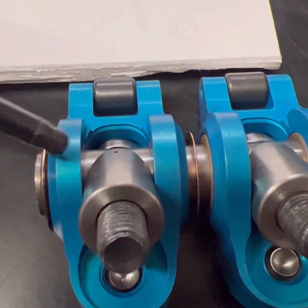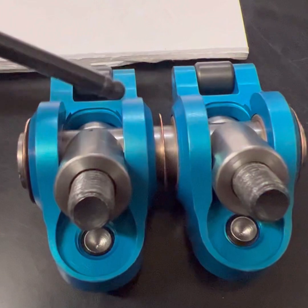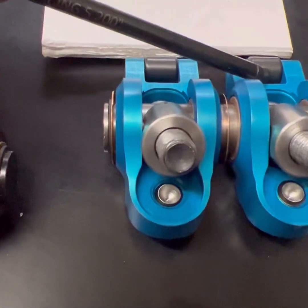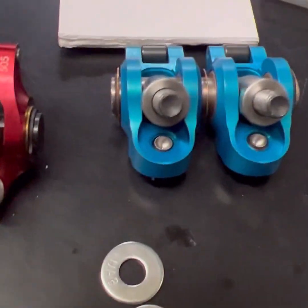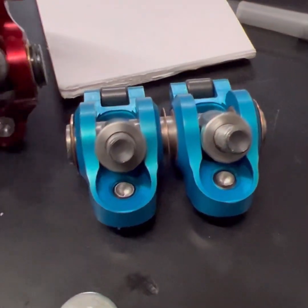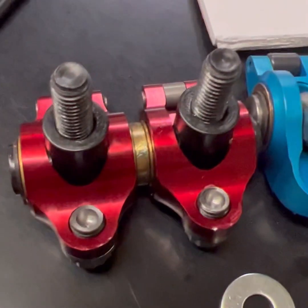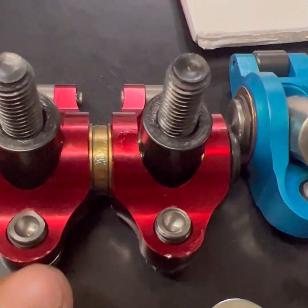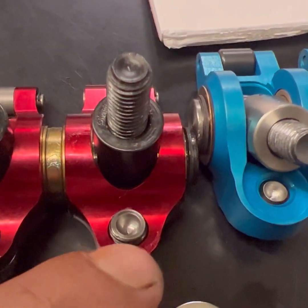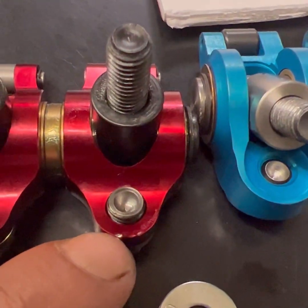The proper thing to do is go with the gauge rockers and order some longer pushrods. If it's not going to work, it's not going to work — that's just how it's got to be for right now. But I can give you a little comparison here. The gauge rockers are a beautiful, really stout part. Coming over to the ECs — also a beautiful part — they're dinged up a little bit because I was half-ass checking for piston-to-valve clearance without taking the springs off and put a little ding in the anodizing.